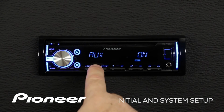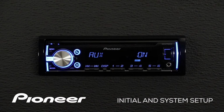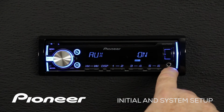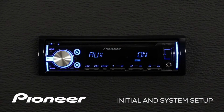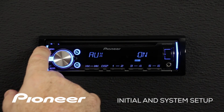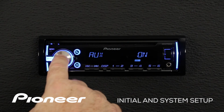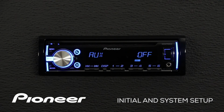We can turn Auxiliary on or off in our System menu, and that means if you use the Auxiliary input on a regular basis right here, you're going to want to leave Auxiliary on, because that will leave Auxiliary in your source list when you press the source button. If you don't typically use the Auxiliary input, you want to switch this off. So we'll switch it off for right now.